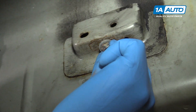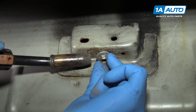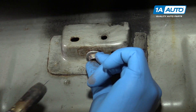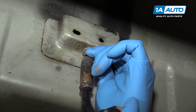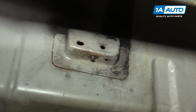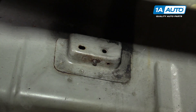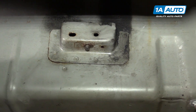I'm going to place the nut and washer here, come in from the back, and tack the threads onto that fixed washer on the back. Once it's held on there, I'll reach up into the center and weld the end of the bolt onto the nut, and that should give us a pretty good grip as well as the added benefit of heating up this bolt. I have sprayed some penetrating oil in there, so I wiped it all out and blew it out with an air gun as best we could, but you may see a little bit of flame here. We have people watching with fire extinguishers while we do this. Safety is always your number one priority.